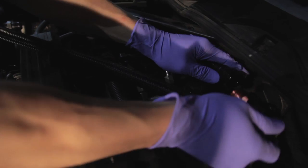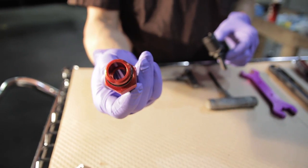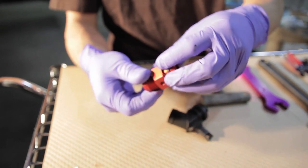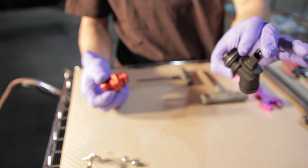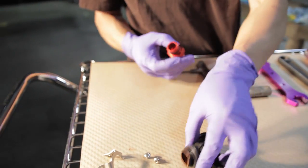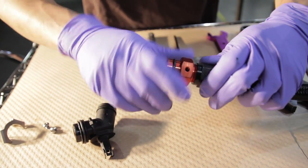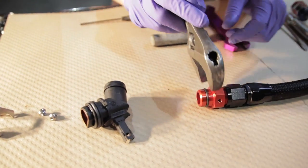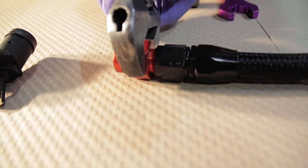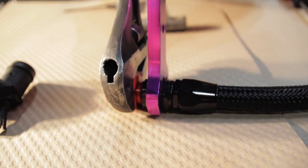This fitting here goes onto the factory hose. The next step is to install the other fitting — the one with the O-ring — into the elbow that comes out of the vehicle. Notice that one side of the elbow is not round and one side is; this fitting slides to the round side. But before we do that, we need to install the hose onto it. Use your two wrenches to tighten it down — they don't need to be extremely tight, just snug. The hose is a predetermined length with straights on either side, so it doesn't matter which way you put it on.